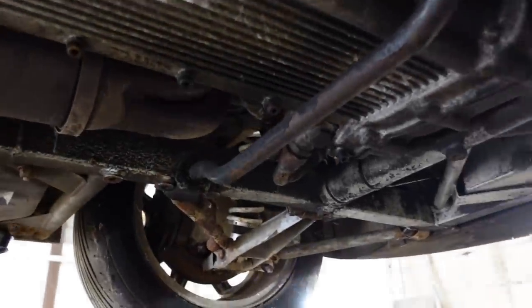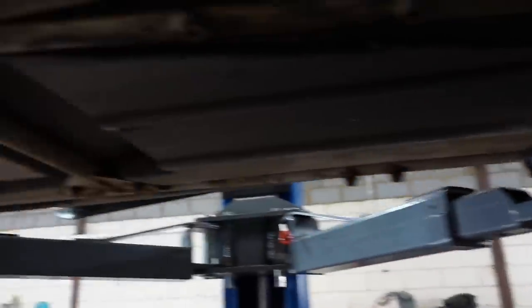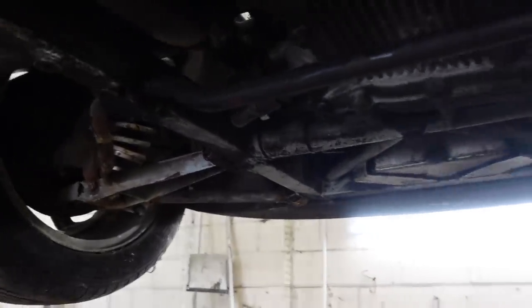The under trays are removed and some more debris came out as well. I'm going to try and leave the engine in, because this is a straight-six so it's not as wide as a V8, and I think you can leave the engine in whilst taking the body off. I'm going to remove the exhaust, take the back box off, and just kind of work it out as I go. There are obviously loads of body mounting points but I'll do those ones last.